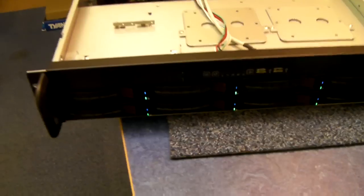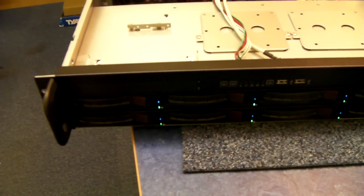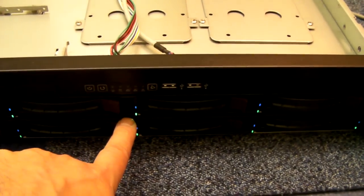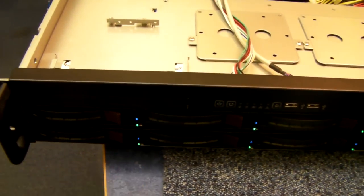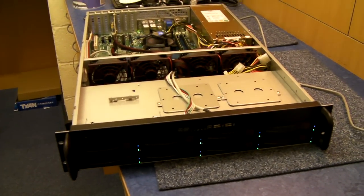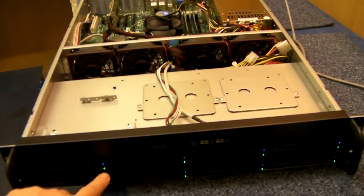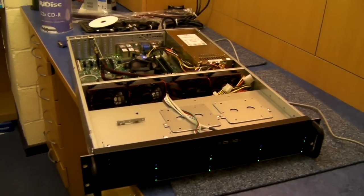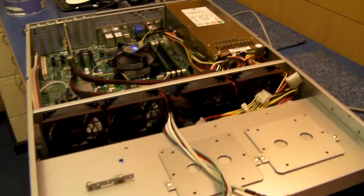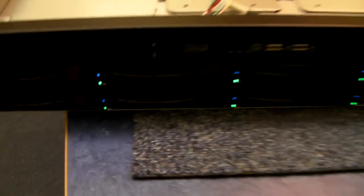You'll notice the caddies have two lights on them. The top one is just the power light, which is on all the time. The second one, the green one, is an activity light, and the RAID card is currently just looking for each drive. Because this is actually set up and still setting up a RAID 5 on the 8 drives internally, these lights will currently stay on while it's doing that. But once it's finished its RAID setup, they will flicker away as they're being used. The lights themselves are much brighter than the previous versions, very clear to see, and also very attractive.